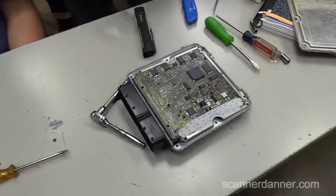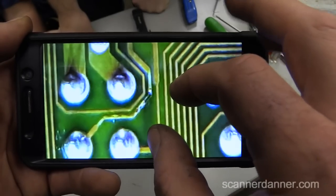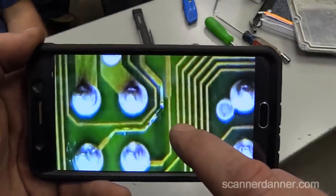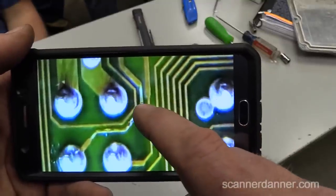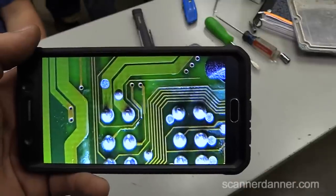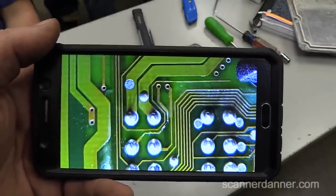Let me show it to you on my phone first. What you're looking at right here is the pin that comes in - that's my computer ground pin. What you can see is the burnt copper wire on the board. This was a caused problem. Somebody jumped something into a circuit that they shouldn't have, and that's what cooked this computer ground. If we reattach this, you can actually take a piece of wire from here to here and attach the two. We could fix this board. But the problem is this car is still not going to start - the timing belt.